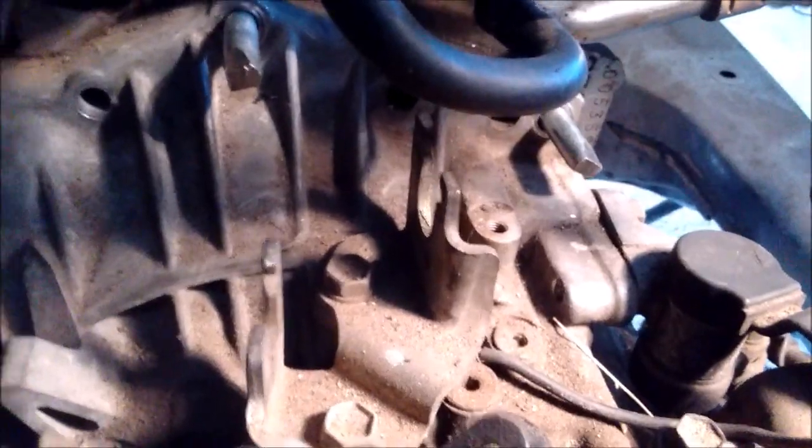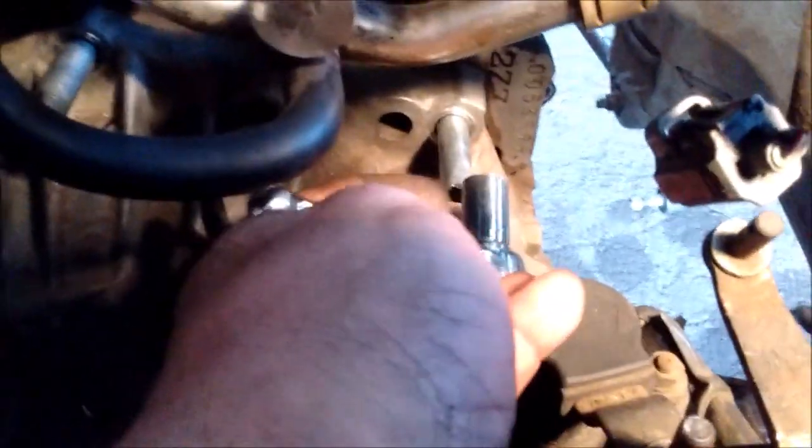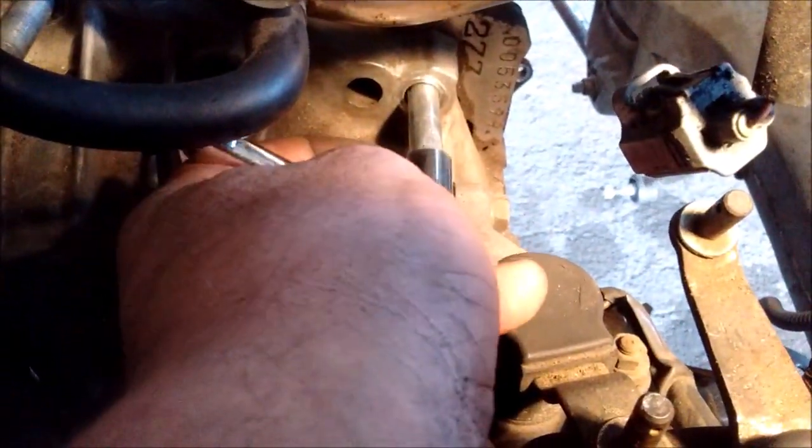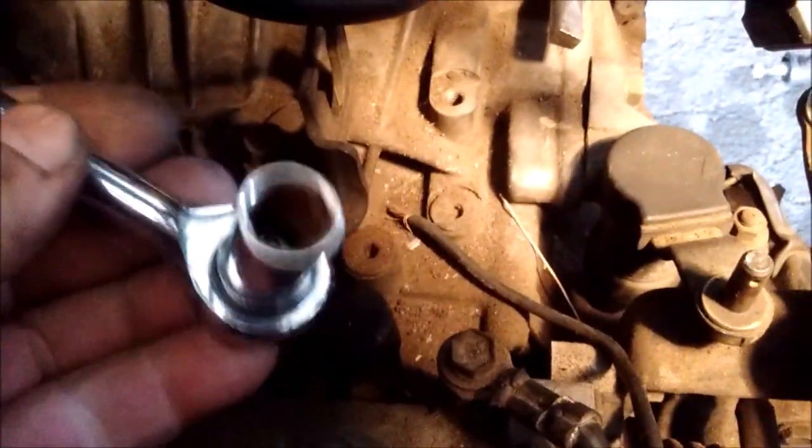So I've put these studs in place. You can see the two studs replacing the two M12 bolts. With the taper on the end of these studs it's possible to fit a little socket on them and turn them to thread them in or thread them out. That's one of the things we did when we prepared these studs — we tapered them so that a little socket will fit over the end.